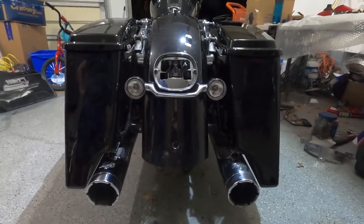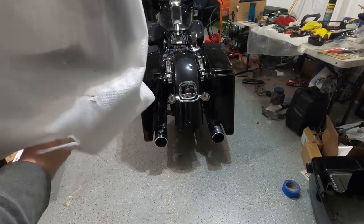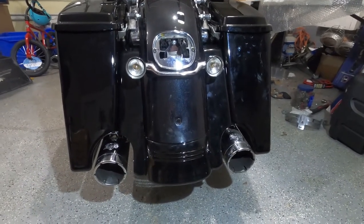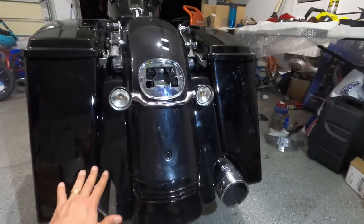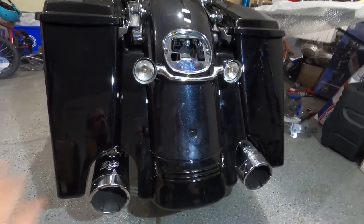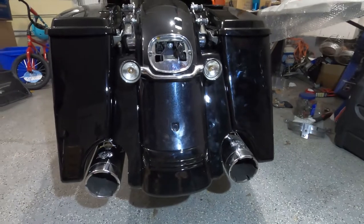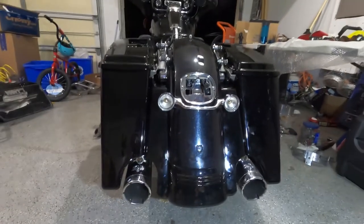Here's the box for the fender extension that will fill the space between the fender and the saddle bags. Look at these guys — oh, that's beautiful, it's awesome! Looks great, and look how it's hugging these exhaust tips. Now the plan to fit this: we're going to use paint tape to fix them in position, then work one side at a time, because we're going to have to take out the saddle bags and drill in the fender from the sides. So we'll take the saddle bags off first to look at everything together and make sure it all looks aligned.